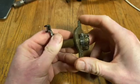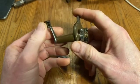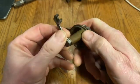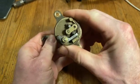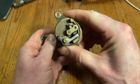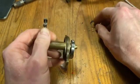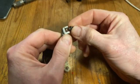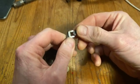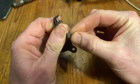Getting very close up and personal with the points. This lever arm basically presses against the cam on the inside of the flywheel and moves backwards and forwards, and you can see the points opening and closing. Now this little fibre block is broken and was basically in here, and you can see where there's been rubbing on the inside of the cam.